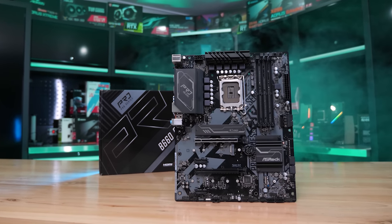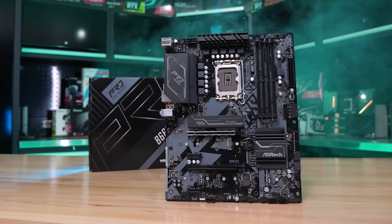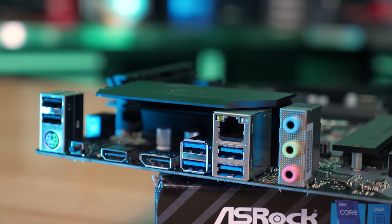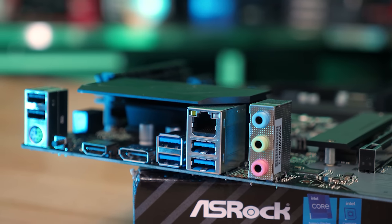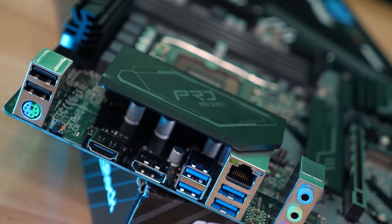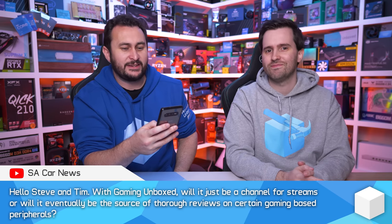The ASRock B660 Pro RS has since had a BIOS change — the board is no longer unlimited power, it's now limited to 150 watts. If you put an i9-12900K on it, which the board says it supports, it'll run up to 240 watts for a short period — maybe a minute at best — and then drops down to 150 watts, so frequency and voltage drop significantly. Adding heatsinks to that board, which already has decent heatsinks, still runs hot anyway. There's only so much heatsinks can do on garbage MOSFETs and power stages. If the board has a hard power limit, even liquid nitrogen on the VRM won't help — it'll still only deliver that hard cap.